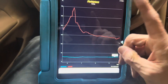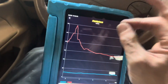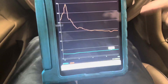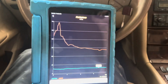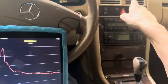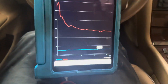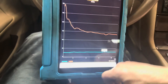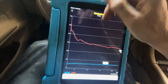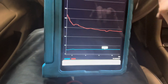Do not try to charge by pressures. Do not try to charge by temperatures. Do not try to charge by dash temperature. Do not try to charge by 'beer can cold' — because there are other things happening in a computer that is telling the compressor to do something, and I could take out half the refrigerant charge and still get just about the same pressures and temperature out of the dash right now under these ambient conditions. If you have a boss who tells you to charge by pressure or temperature on a variable displacement or variable speed compressor being controlled by sensors, superheat, or subcooling — that's wrong.